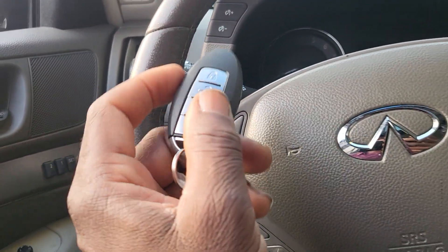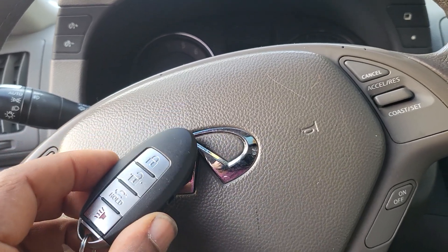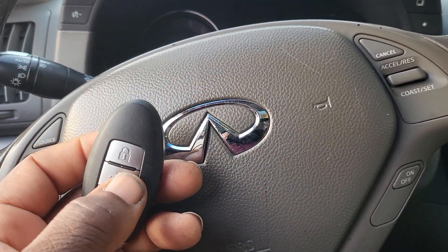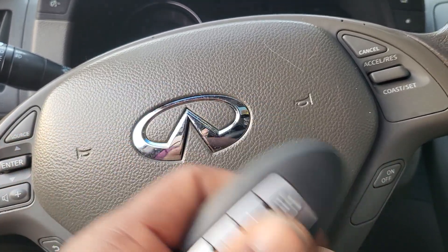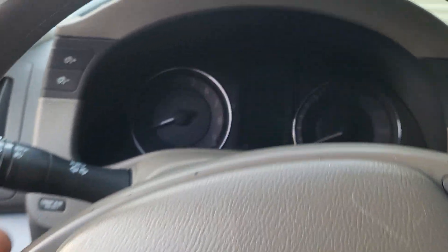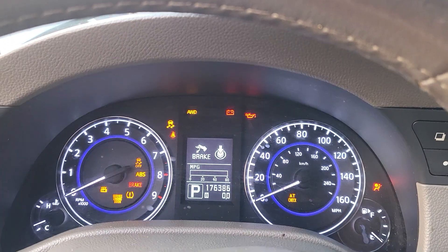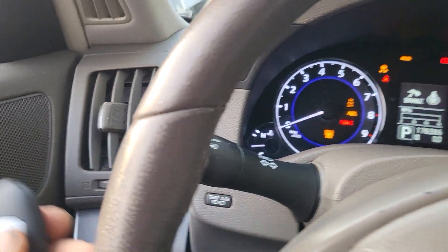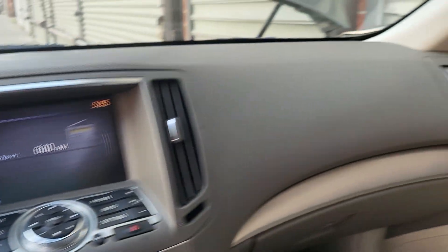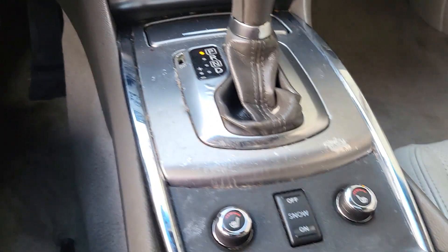These cars really need proper diagnosis. We came in, communicated, and as soon as we finished putting in the charge, the system, the blown fuse — the ignition came on. Everything was good, but the car still didn't want to start. We looked at the data on the BCM: zero keys. We went in, reprogrammed the key, set it up correctly — everything is good, now the car is running. If you have any problem or question, feel free to ask. This is Mohamed Haroun Idris.